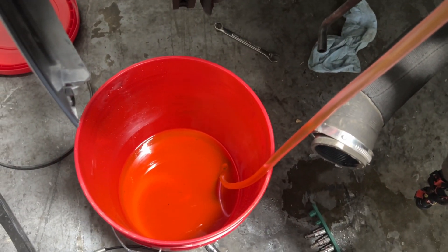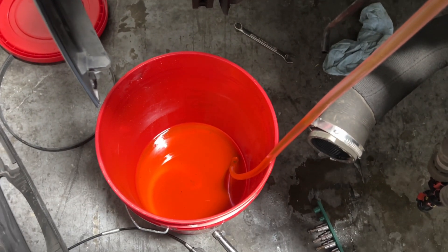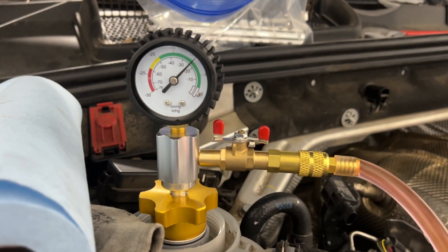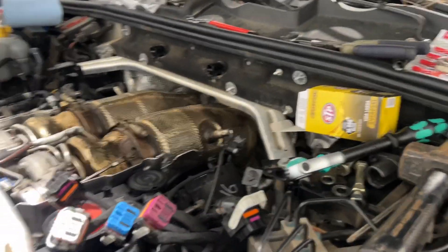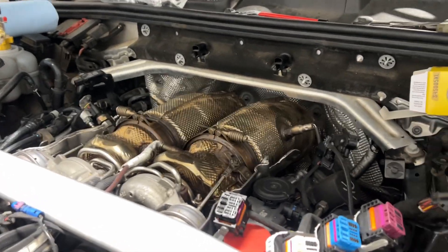As you can see, it's pulling it down pretty fast. Once it gets near the bottom there, if you need to top off your bucket, you can actually dump more in. But I need to go mix some more up, because I only have concentrate. Oh crud, I'm running low — you just shut that off. Coolant drains back down into the bucket. This continues to hold your vacuum. And this makes sure that your system is filled with absolutely no leaks and no air bubbles, because you've literally sucked all the air out of the system.